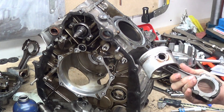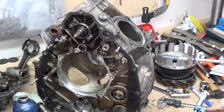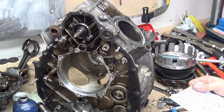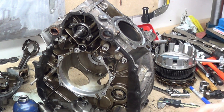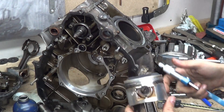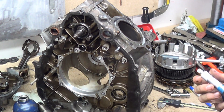So we take our piston — which piston's which? Doesn't matter, we're only doing the preliminary. So the piston limit on this piece of paper is 77.86. So 77.86, which we just do with a micrometer. And you measure it here at the bottom of the skirt. So if we get a micrometer and unlock it.